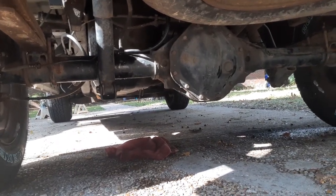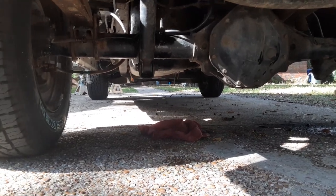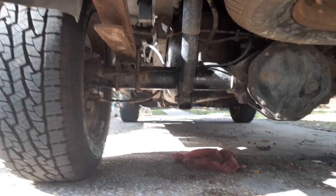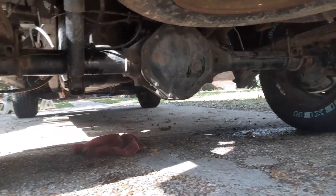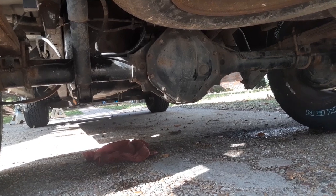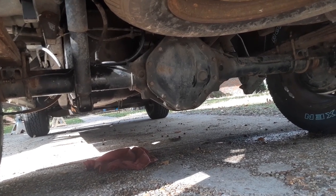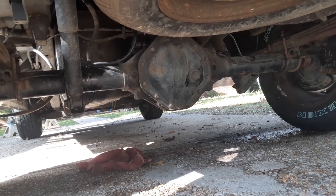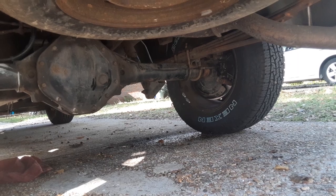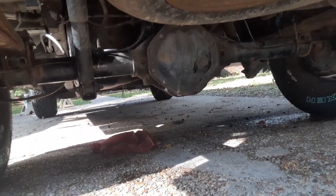But yeah, if you do this, definitely after a couple of days, you want to probably pull the wheels back off of it again and double check that those U-bolts are tight. Crawl over there and make sure that the four driveline bolts are tight. I hit those down at about 100 pounds, which is probably excessive, but I'd rather be excessive than not have enough. But there it is. It's done. Thanks for watching.